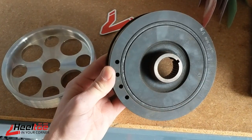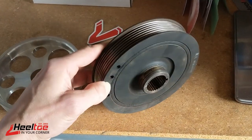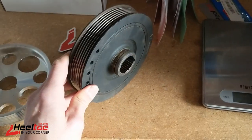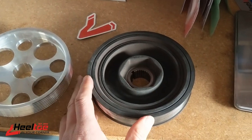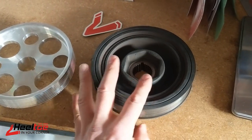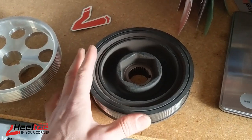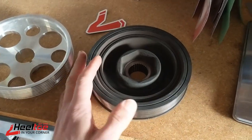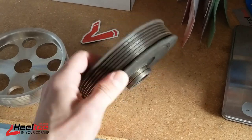There's a harmonic damper and there's a balancer — in a lot of engines these are called balancers, partly because there's a little bit of mass taken away here to balance the part so that when it spins it doesn't vibrate. It is common for many engine manufacturers to balance the rotating assembly. The crankshaft needs to be balanced, and a lot of manufacturers include this pulley in that balancing process. But in a Honda engine, this crank pulley isn't actually part of that balancing process in the bottom end. Honda even calls it a pulley on their parts website — it's a crankshaft pulley, not a balancer.